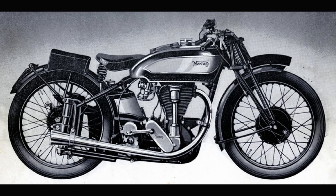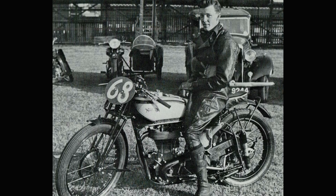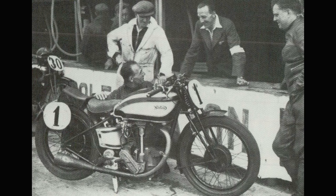I'd like to hear from anyone who knows more about it. I'm assuming that the parallel check springs gave some form of damping, and on a long race like the TT the side dampers might slacken off and wear and not work as well, while having those parallel check springs doing a similar job meant the rate was constant - it wouldn't wear. I'm also assuming there's a slight weight saving in the unsprung weight of not having the damper mechanism, though I'd have thought that would be minimal.